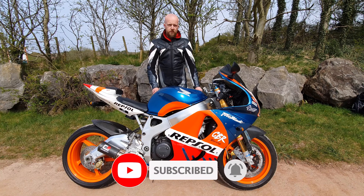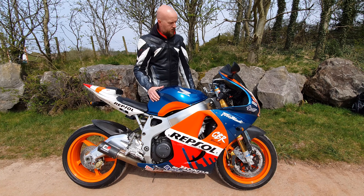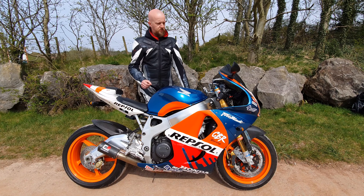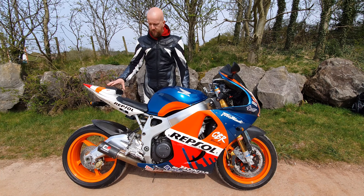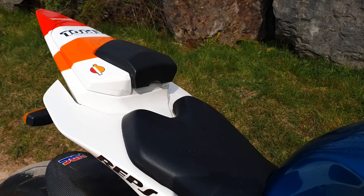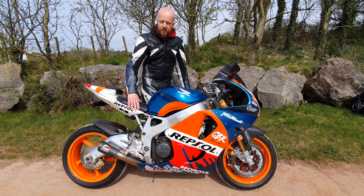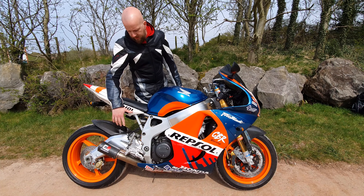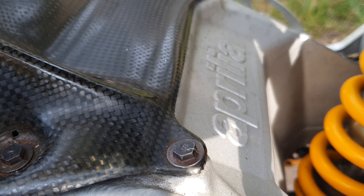From that fairly well-grounded starting point, there's been a substantial amount of work done to get the bike to what you see today. Starting at the back, the first thing you'll notice visually is this tail piece — this is actually from a Yamaha R6, sat on a custom fabricated subframe. Moving further down, you'll notice this is not the original Fireblade rear setup — the swing arm was actually lifted from an Aprilia RSV.